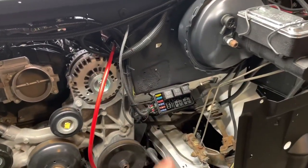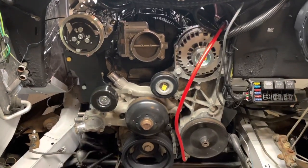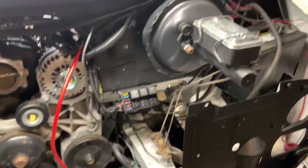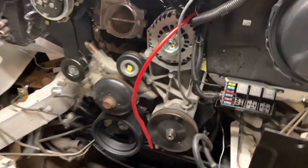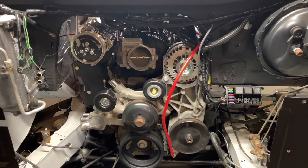That might also do a little cycle thing — make sure the fuel pump is powered up. I can spin the engine. I am going to put a new oil filter in it. I really want to just hear the thing light. After I get fuel, I want to hear the thing spin and fire before I put the radiator and all this junk back in it. Because once the radiator's in, there ain't no room to get to anything, especially with the shroud and fan on it. So first thing is finish building the cables, button up this area, put a ground cable on somewhere on this casting, get all that done, start building my cable ends, and probably go ahead and put oil in it and put my plug wires on.